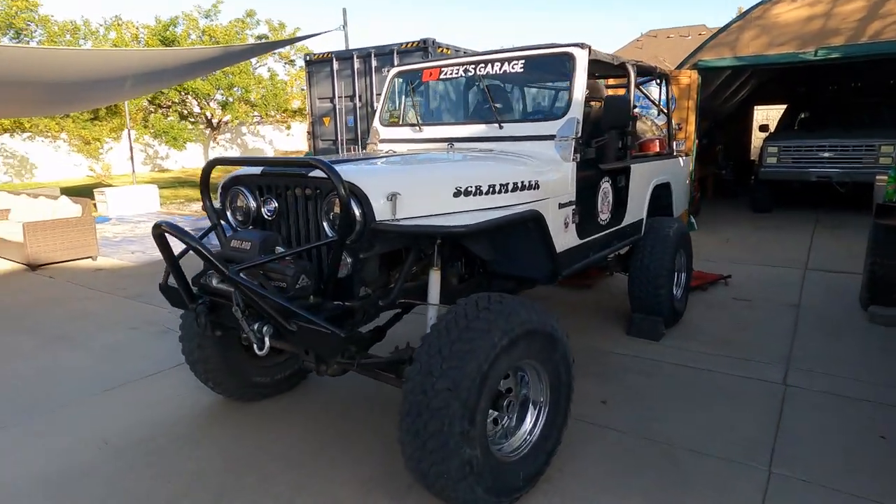I'll get all the stuff ready to go on this. We'll set you up on a time-lapse and probably just lower it down and then pressurize the whole system to see what we're up against before we just drop the whole tank clear out of there. It's a 33-gallon tank and there's about 28 gallons of fuel in it, so I figured I was going to need another set of hands. That's a big old tank to wrestle back up in there — necessary evil, can't have a fuel leak.